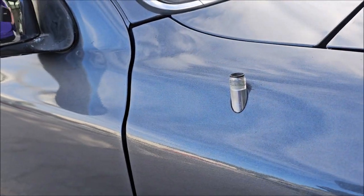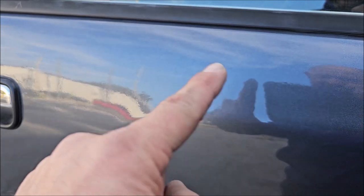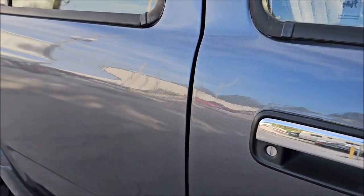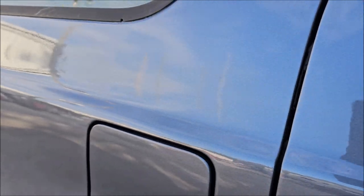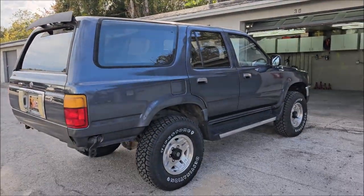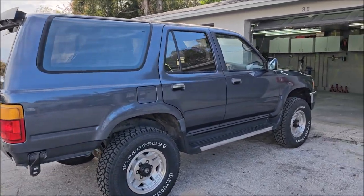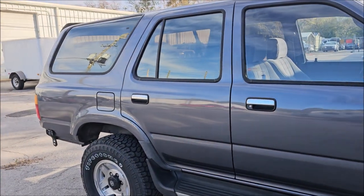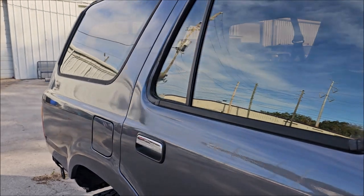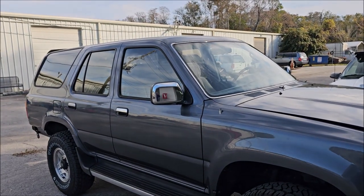The decal was literally embedded in the paint. I had to use 80 grit by hand to remove it. And if you're looking in this area where I'm showing you, you'll notice there are no crazy dramatic scratch marks popping out at you at all. I put three coats of a high build primer on it, and that seemed to cover them up pretty good. The real way to do it is what I did — I hand cut it all off with 80, then backed it out: 80 to 180, then 320 and then 400. It wasn't smoothing out as much as I liked, so I buried those scratches with primer.